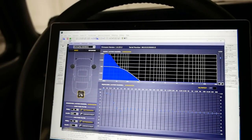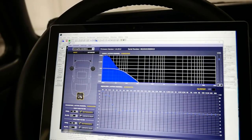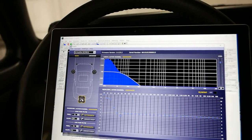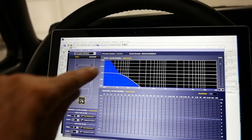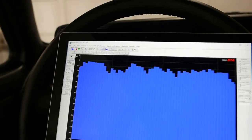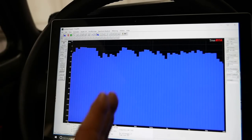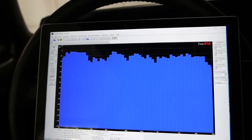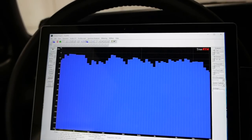The speakers in the doors are flat down to about 50 hertz. I used a sealed enclosure, which doesn't give as linear a bass response — it tends to drop off below 50 hertz on the sub, so I've had to increase up to 20 decibels down very deep. This is my frequency response analysis software called TrueRTA, divided into one-sixth octave bands. I've got it pretty good now. The human ear is really only able to hear plus or minus two to three decibels — tweaking down to the one-decibel point is a waste of time in a car.